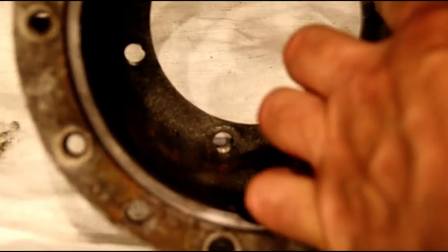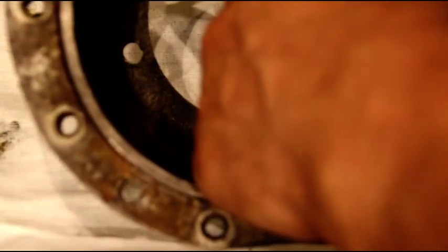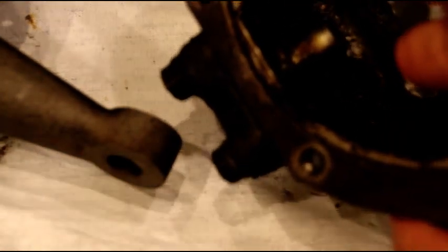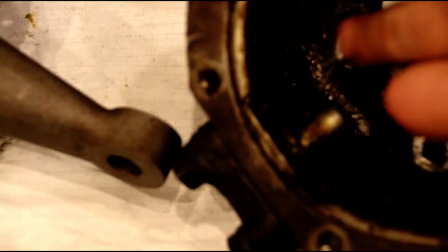Chuck this guy in the drill and go down in there. Now your holes — these two side ones are easy because they've got the most clearance. Your ones that are near the kingpins, you've got to go nice and easy because you've got to take a big chunk of material out of there. Here is another knuckle I did — this one's still dirty, but you can see the flat area. Where the kingpin is, you've got to take some of this area out, so you've got to go nice and slow with the drill. But it is a hand operation.